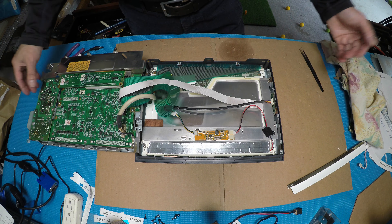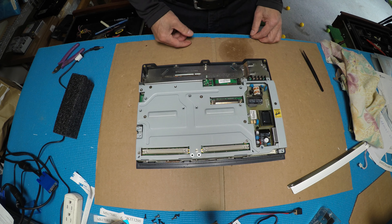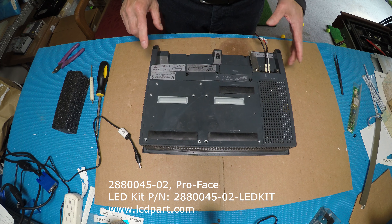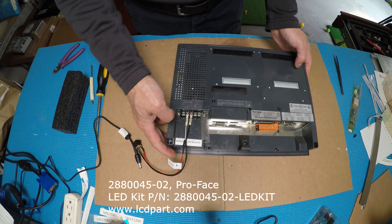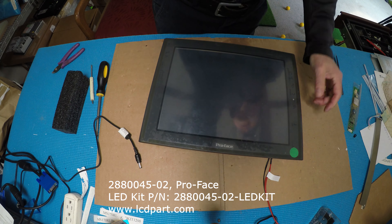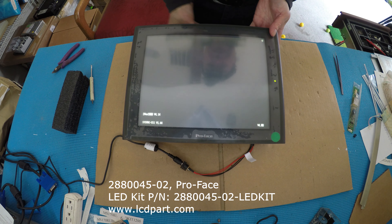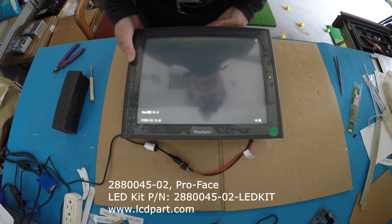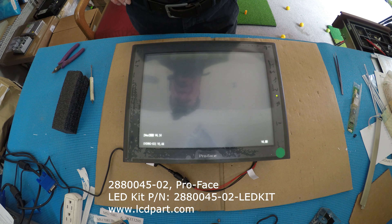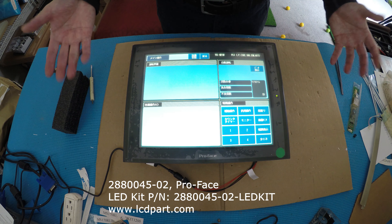It's done. Put it back, put the screws back, and put the back cover on. Put the screen in to hold the chassis. Connect the 24-volt supply — positive and negative. Shut off the backlight and turn it on. It's on! Takes just a couple of seconds to start up. See how easy it is — thank you for watching.